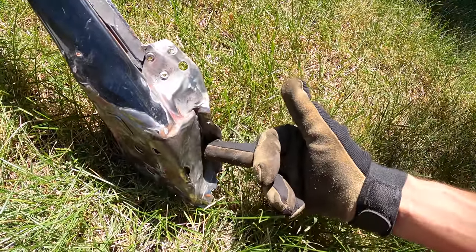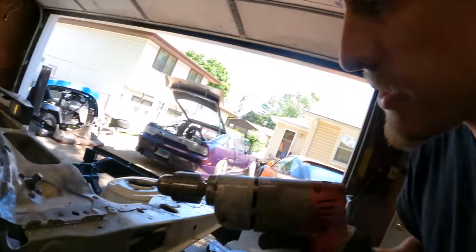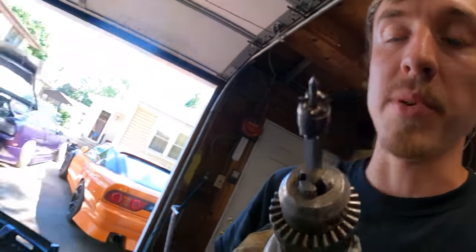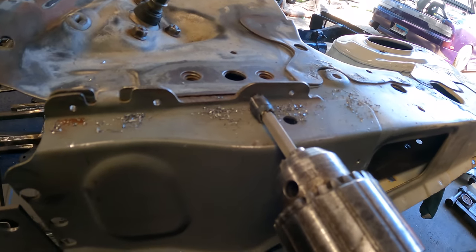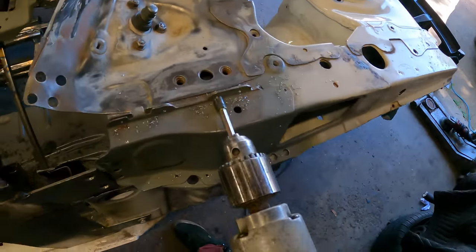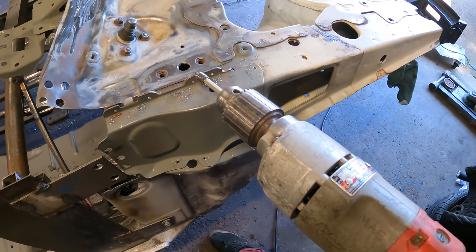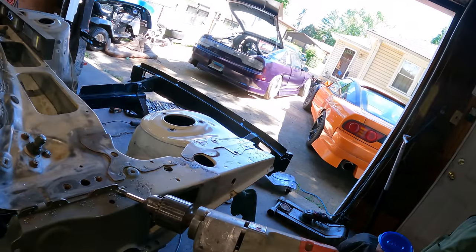This is the curved section I was talking about trying to weld, and it looks like I need to drill out some more spot welds. The way I'm doing this: I'll drill a tiny pilot hole with a smaller drill bit first. I've found it's a lot easier to let the spot weld drill bit have a center hole to sit in so it stays stabilized. I've tried using a center punch or even no punch at all, but the bit will just walk around and sometimes chip the teeth off. This is the best method I've found.